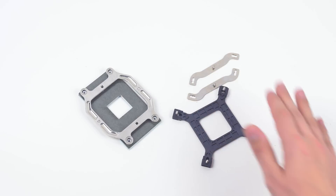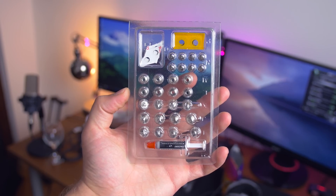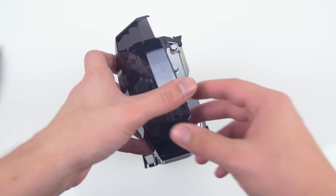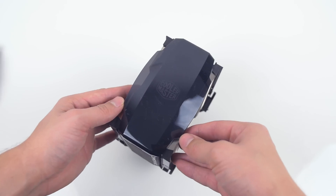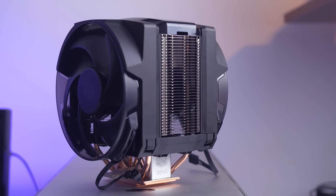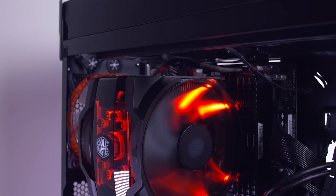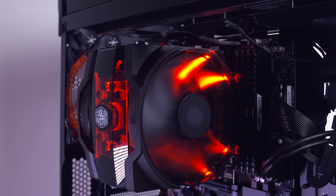In the package we receive both AMD and Intel brackets, this plastic housing with all the needed mounting hardware, an additional aluminum top piece for the cooler — where the stock one is this glossy transparent one — and you can also download 3D printing templates for customization. Moving on to the cooler itself, we have two 140mm Silencio fans, good quality there, that move quite a bit of air and have fantastic static pressure. They are illuminated in only red color, so your color coordination inside the case must be thought about.